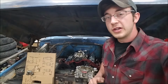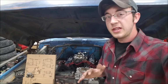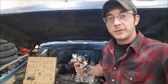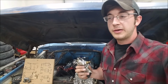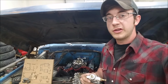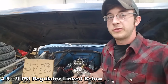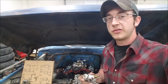All right, I'm sure at this point a lot of you already know where I'm going with this, but the easiest way to mitigate all of these fuel pressure related issues is to simply run a fuel pressure regulator, if I don't drop it on the ground. There are several different versions of these on the market. I've got another one here I'll show you in a second. This is the one that I prefer, and I'll leave the link below so you can take a look at it. It's just a normal 4.5 to 9 PSI adjustable regulator for a deadhead style system. That means you guys with mechanical fuel pumps, this will work great for you, where you can keep consistent fuel pressure to your carburetor.